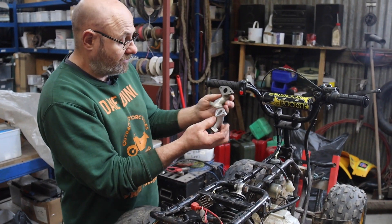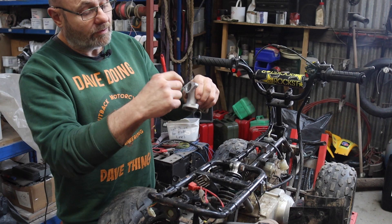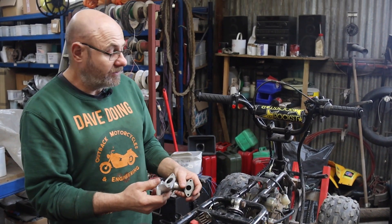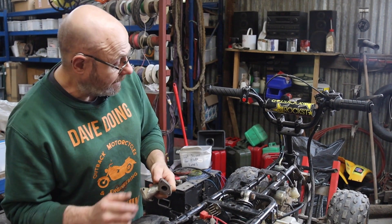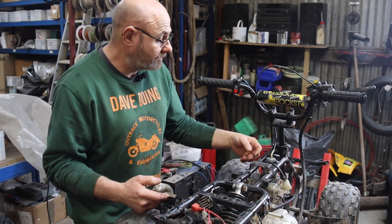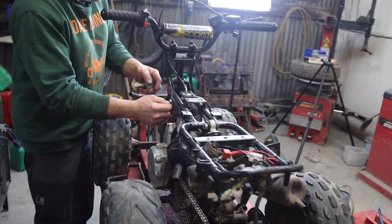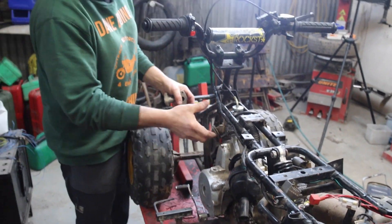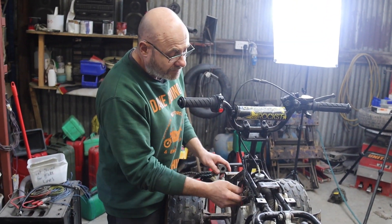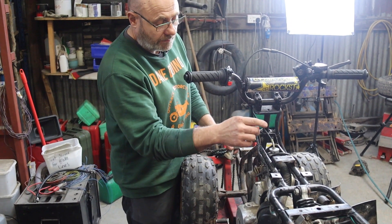This different-style manifold won't work because it's too short, but it has a much larger diameter hole - the bore cross-sectional dimensions are bigger, so that would work better with a bigger carb. People think stick a bigger carb on and it'll go better - not if it's strangled by the inlet manifold, completely pointless. What I'm going to do is undo the bolts, take the carb off. Basically this choke lever is jammed solid against the frame - that's not going to work. There's a lot of plastic on here, so putting the carb out here would be better with the plastics on.